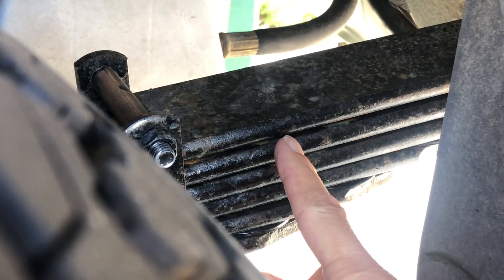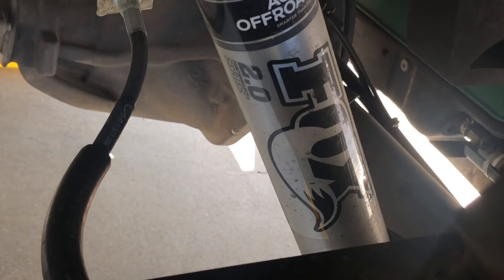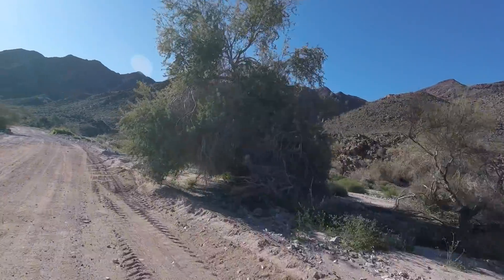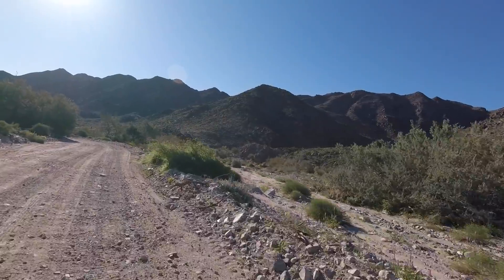What the suspension package does is replace the single leaf spring that the chassis comes with with — I think it's seven springs on the new leaf springs. Leaf springs absorb energy, so they're absorbing the energy of all those bumps. But you need some way to dissipate the energy, and that's what the shock absorbers do — or dampers, as they call them in Europe. Whereas before, our bodies were trying to dissipate the energy because you're just rocking and rolling over everything — curb cuts were the worst. These vans, even though they may be rated for the weight we carry, don't perform as well at that weight, and the new suspension package takes that into account.